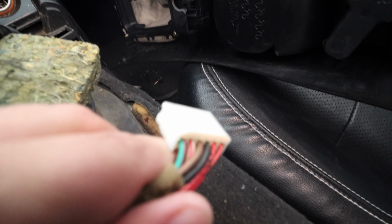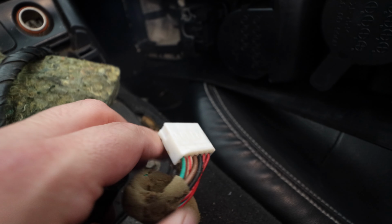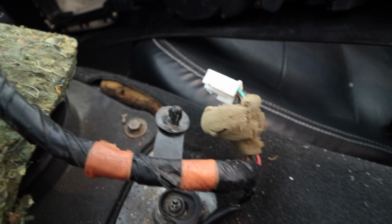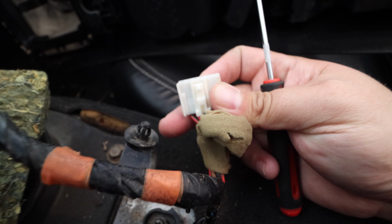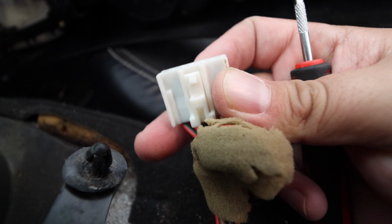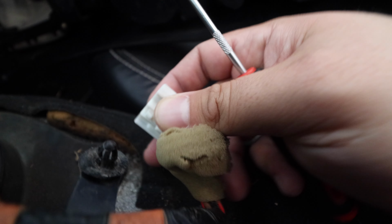Okay, so I took off the center console. Important thing, when you unscrew those different screws, you saw me struggling. You're gonna have the wire that you're gonna need to go ahead and take off, because that is the adapter or the harness for the power windows. So you'll wanna do that.